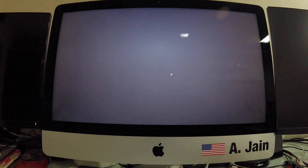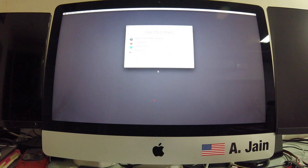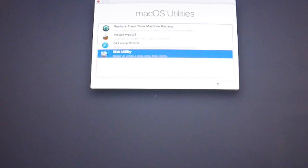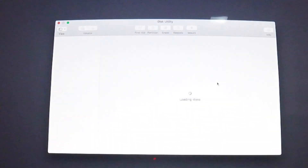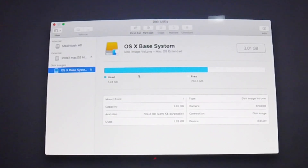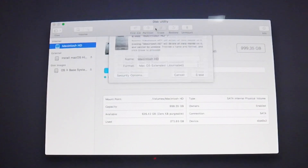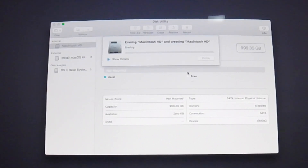Select your language and you'll be given a menu. The first thing you're going to do is go into Disk Utility — this is a final warning, this will erase all contents of your disk. Go to Macintosh HD and click Erase. Keep the name as Macintosh HD and make sure the format is Mac OS Extended (Journaled), then click Erase. Give it about five to ten minutes to complete.